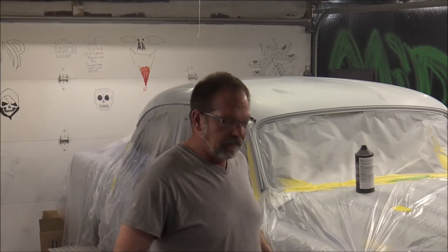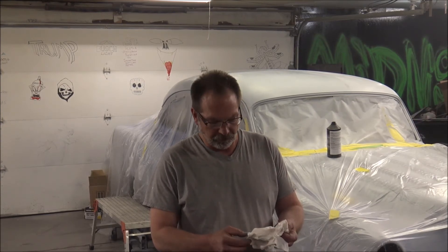What ends up happening is you end up with the wrong product to work with. So when we were going to paint it last week, he provided us with what he called sealer. And I regret at this moment, on one hand, not researching the product that he purchased for us. What he purchased was a very fast curing epoxy primer, not a sealer. He claimed it could be used for a sealer and a primer. Well, that company makes a sealer-slash-primer, but the product he bought was not that.